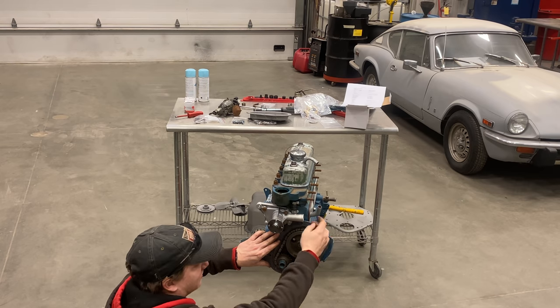Here it is in the correct green. Once it's dry I'll get it out of here and get it unmasked. The fan and pulley on the Sprite should be yellow so I'm actually going to powder coat these to make sure it's really durable. It's not a very good look when you look in the engine bay and the fan is all scratched up. So I'll load up the yellow powder coat and get these done — it only takes about 20 minutes.